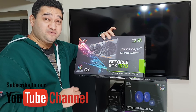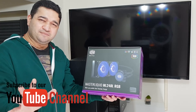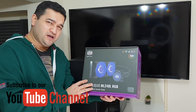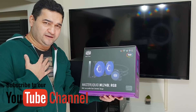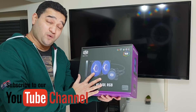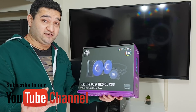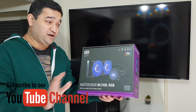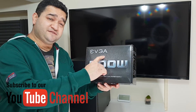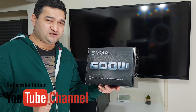The graphics card is the ASUS ROG GTX 1070. For the CPU cooling system it's a bit of overkill since I'm not doing any overclocking, but I chose it specifically because I wanted less noise coming out of the case — that was the only reason, but if you don't want to use it, skip it. For the power supply I've gone with the EVGA 600 watt 80 Plus, which is ample enough for this build.